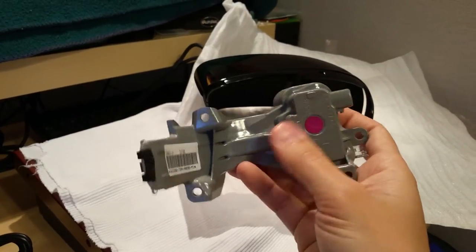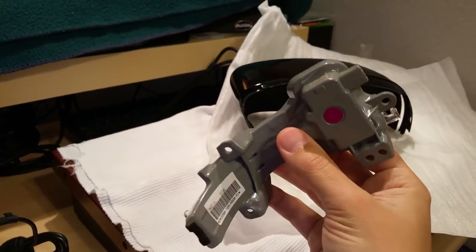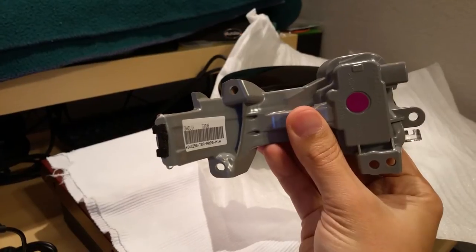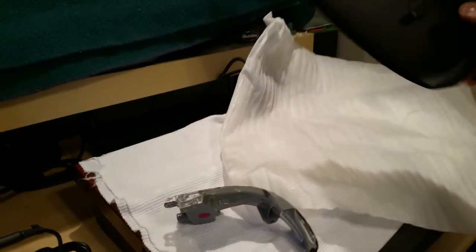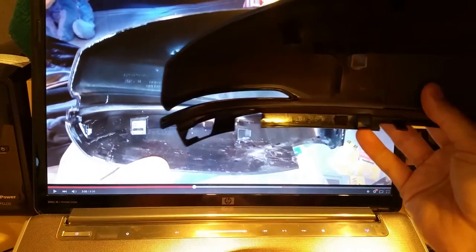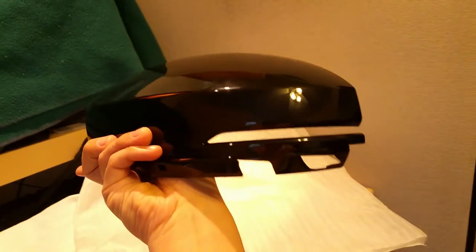The basic way to install it — you need some self-tapping screws, which you can purchase at any local hardware store. The mirror base on the EX has the holes for these but they're not tapped, so you're going to need self-tapping screws. The LED winker skull is the most expensive piece, and this is on the EXL. It looks halved because the bottom piece is clipped on, and it's easy enough to reuse that bottom base and snap it onto the EXL. The LED winker will fit like so.